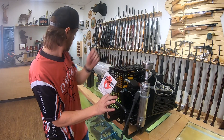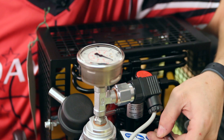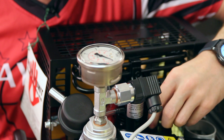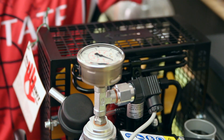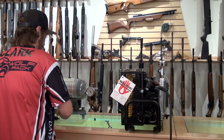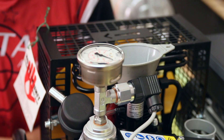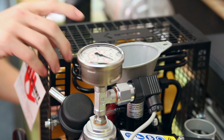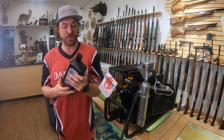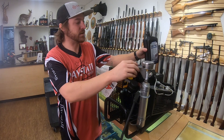The only other thing we have to open when putting oil in is the vent screw right next to it. This is a 14-millimeter nut — just break that loose and take it off while oil is going in. Pull our oil plug out. A funnel is definitely going to be another necessary tool here — you don't want oil getting spilled all over your unit. As per manufacturer spec, we put three-tenths of a liter — that's 300 milliliters — so I'm going to do about a quarter first and check it.